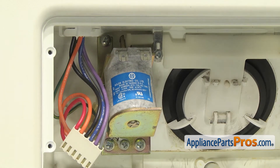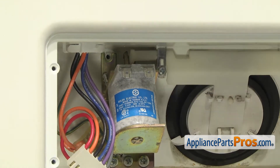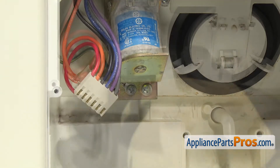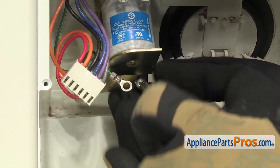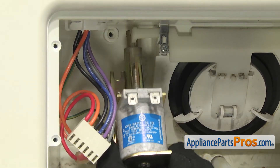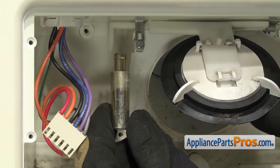Then we're going to use our Phillips screwdriver to take the screws out. The first one is up here on the top — I'm just going to reach in and take them all out. If you drop a screw up there, don't worry, we'll get it in a minute. Then we'll take the lower screws out. Now that we have all the screws out, we can pull the solenoid assembly out. The arm might stick to the door, so if you have to, you can pull up on the door and unhook it from the solenoid plunger.